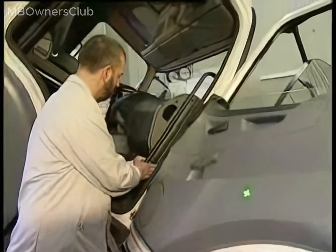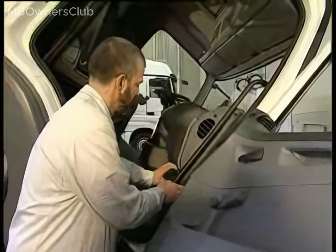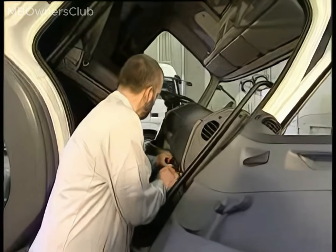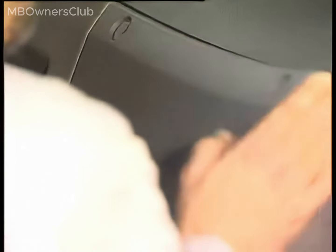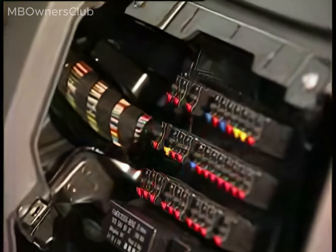If the battery voltage supply to the regulator field stage is not guaranteed, the alternator is only excited above 1500 revolutions per minute. This excitation due to intrinsic remnants matches the emergency idle function. A look at the base module fuse holder confirms it.